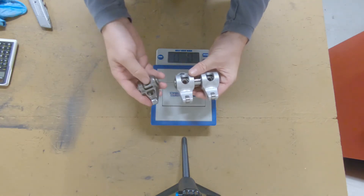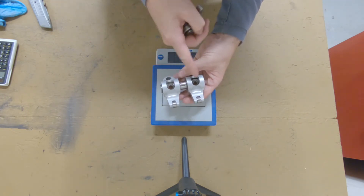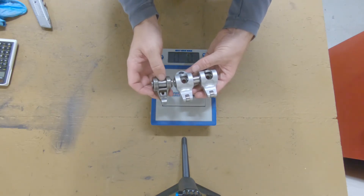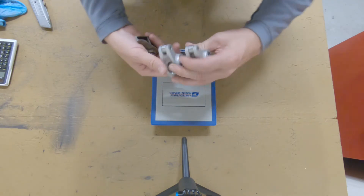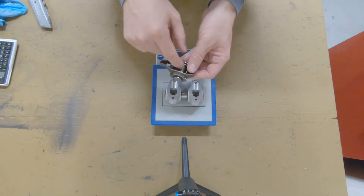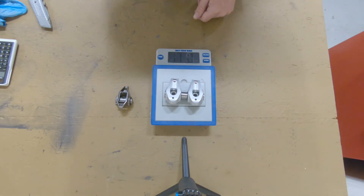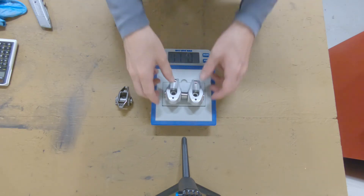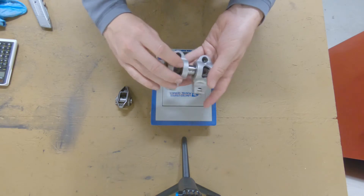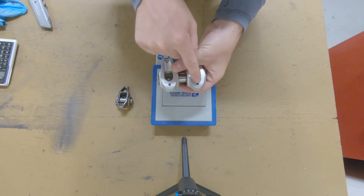What I want to point out is the shaft continues through here, so a majority of the weight is in the shaft — compared especially to this one, which doesn't have a shaft mount. These are shaft mount roller rockers; the factory ones are individual. The seats are pressed in here from a different material for the push rods. And then there's our metering hole — that hole is a little bit smaller than the factory one.